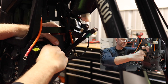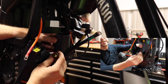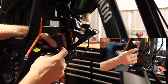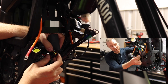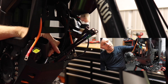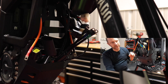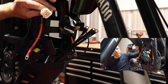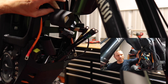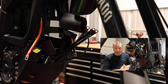Now if you wanted to delete your kickstand, this is a good opportunity to do that. You can disconnect it from here — this is that connection — and you can use some smaller shrink wrap if you wanted to waterproof that connector. We've got our connection here, the motor connection there, and the white one from the upper part of the harness will be heat shrinked as well. So we've got five things that we need to heat shrink down here.